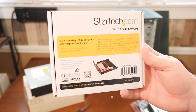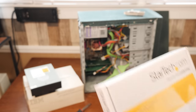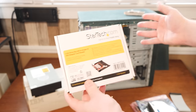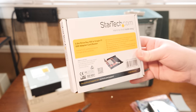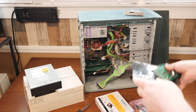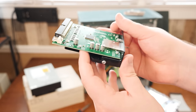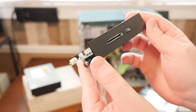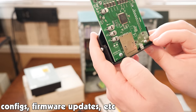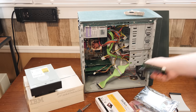So I don't want to use this anymore. I was thinking about going to a front loading three and a half inch drive bay CF adapter, but I just don't want to use compact flash cards anymore. And unfortunately I cannot find any SD to IDE adapters that go in the front. So I found this instead — an SD card to SCSI adapter, same basic idea but it's a front loading one with a black 3.5 inch drive bay bezel. Front loading SD card instead of having to go to the back. I already have a SCSI card in there, so hopefully it's just a matter of hooking up that 50-pin cable and making it work.